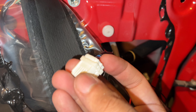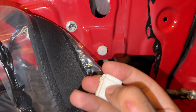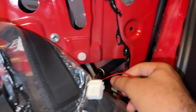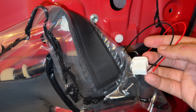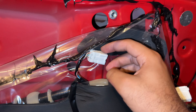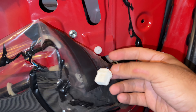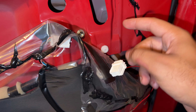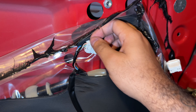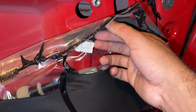Here we just have to remove these little retainer clips from this connector. Gotta put a little flathead through there, remove that so we can put these two wires — the black and red — in there. On this side the black goes with the black, and the red will go with the white and red. On the passenger side it's the opposite — it's flipped around — so make sure you put it in the right one.